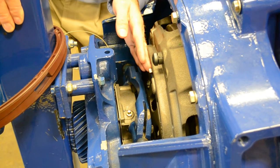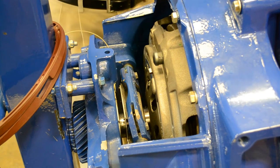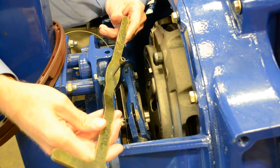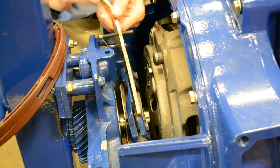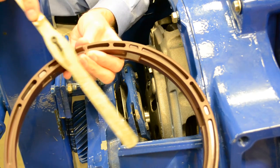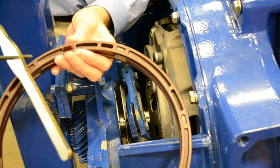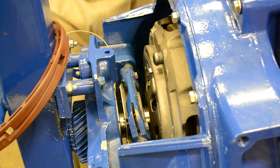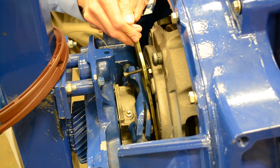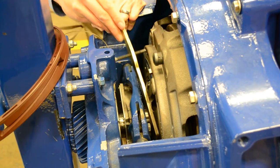As you'll see here, I still cannot move the tab over. There is a tool in your shops called a reset tool. This tool gives a little bit of leverage to help move that tab back over to new. What we're doing with this tool is putting it in the slot next to the tab — the end of the bolt in the slot next to the tab — so we don't break off the tab. With someone holding the clutch pedal down to the floor, we put our tool in here next to the tab and try to move it. Again, we still cannot move the tab even with the tool.